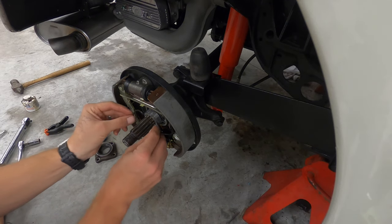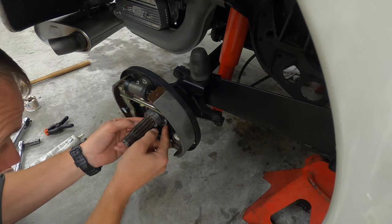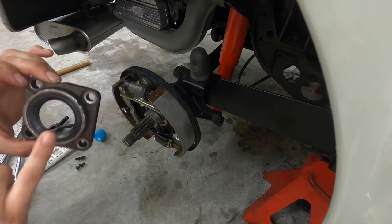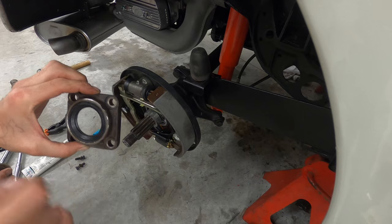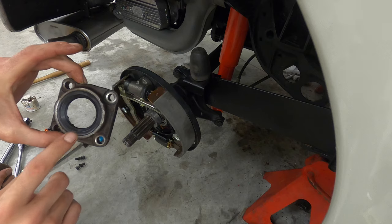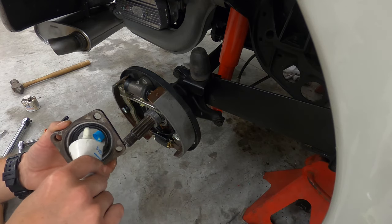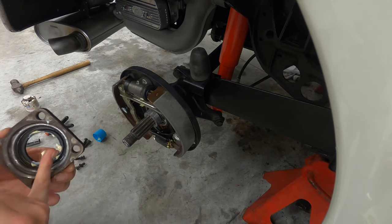I've lubed up my O-ring and put it on very gently. The back end plate keeps wanting to come off so make sure it's all the way around. I've already replaced the seal here — I just pushed it out with a screwdriver and then pressed it in by hand until it was even with the top. There are different designs for these bearing caps or bearing cups. I need to lube up the inside and outside of this area.